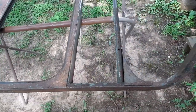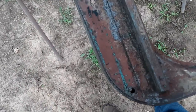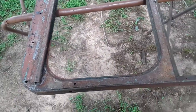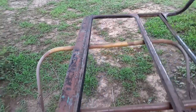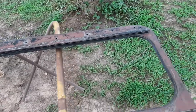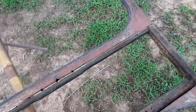It's been a few days since my last clip. Yesterday I came out here and put some more stripper on it, and I pretty much got it all the way down to the original primer. I think I've got it good enough where I don't have to do a lot of sanding. Right now I'm trying to figure out these holes — I'm thinking about keeping those on the top. I've got to knock them out; they're pulled in pretty good, so I'm going to straighten those out, get this thing sanded down, get the spot weld holes drilled, get that screw back in place and welded up. It's coming along pretty good.